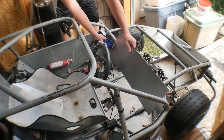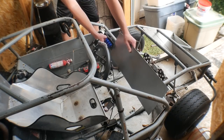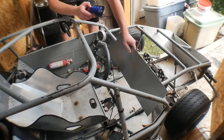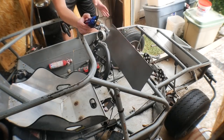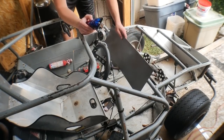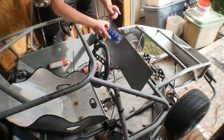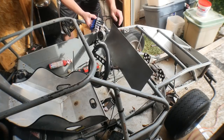If I mount it just above the steering shaft, I would definitely have enough room with wires to mount this up, drill it and bolt it down. So I'm going to put this exactly where I want it, put a line across, cut it as evenly as I possibly can. This is steel, so I might just weld it onto the cage super lightly because it's so thin I don't want to burn right through it. Cut out a little area for the switch panel, bolt that in, and then get started with wiring.